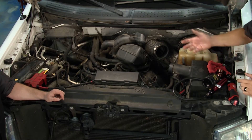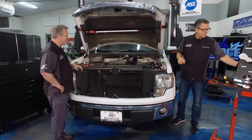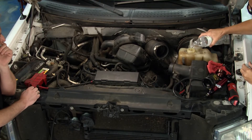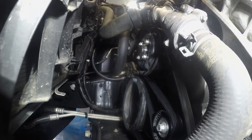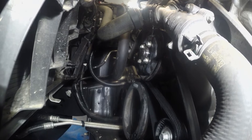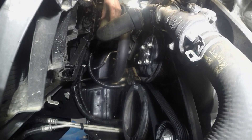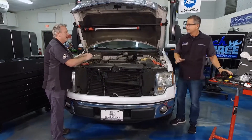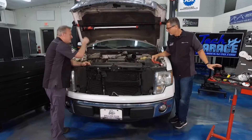There's nothing in there when we try to pressure test, which probably indicates a coolant leak. Let me add some water. Whoa — we don't even need the pressure tester. See what's coming out right here? It's this hose — one of those Ford hoses that seals on the inside instead of having a hose clamp on the outside. Those are prone to leaking, and there is our problem.